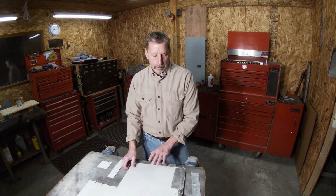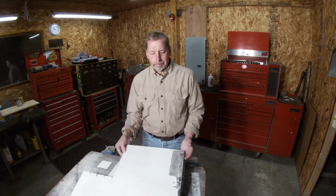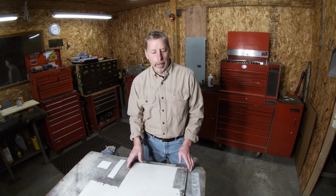Years ago, everyone was taught you have to grind the metal down completely clean, take all the paint off, E-coat everything, get your Bondo to stick. And that's the way I did it for years. Most of the manufacturers now, they don't recommend taking any of their coatings off the metal. The only reason I do is if it's gouged or scratched, but I do it to a minimum. Everything else I like to leave on there and then just finish it down in 80 grit.